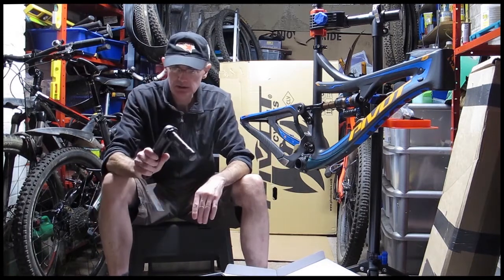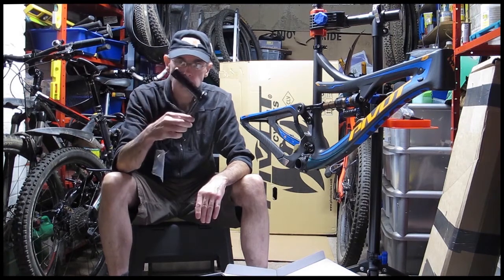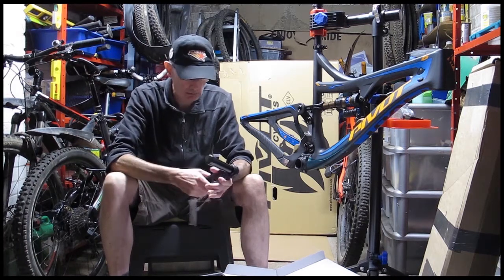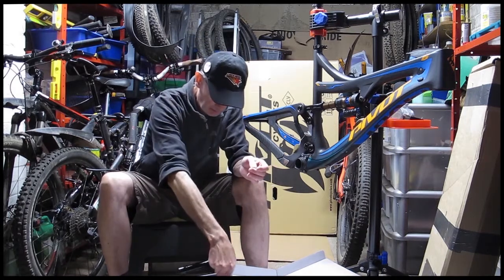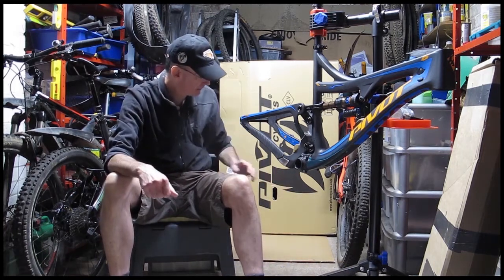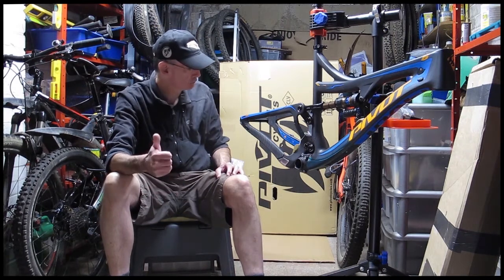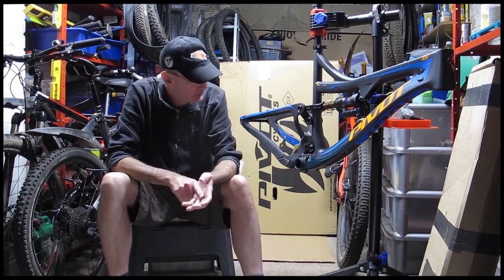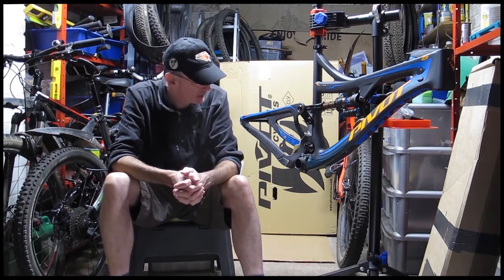The other thing that surprised me is this is the non-drive side crank, meaning the crank is secured on the drive side, which is different to Shimano. And of course for £50 extra I get to keep the 1x12 on the Pinnacle as well, which is great. If you're going to buy one of these, there's a boost and a non-boost version — I had to make sure I bought the boost version so the crank is offset appropriately.